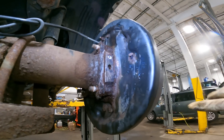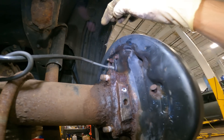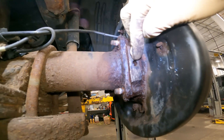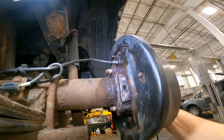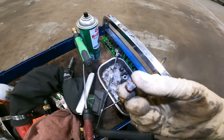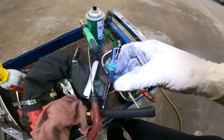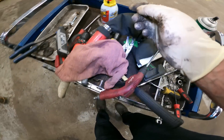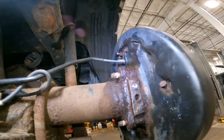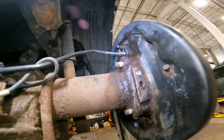The plan was to remove this whole thing and take the sensor out that way, but when I went to crack the bleeder free it wouldn't budge. I gave it some heat and it still wouldn't crack free. Things escalated — I got the Dremel out and did a little Dremel work, a little picking, a little drilling. This is the only piece of the old sensor that remains. We have our new sensor all prepped and greased. We had to ream the hole — not a little bit, a good amount — then spray cleaner in and blow it out. We did that a couple of times while rotating the axle to make sure no swarf is on the ring. Let's get the sensor in.